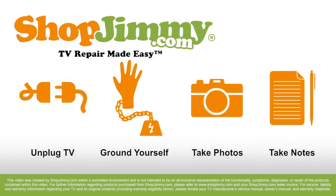Please make sure that your TV is unplugged and that you are protected from static electricity. There are various ways to eliminate static electricity, but the most common way is to use a grounding wrist strap. Take photos and notes often to help remember the location and orientation of parts and wires. Feel free to pause and backtrack through this tutorial as much as needed.